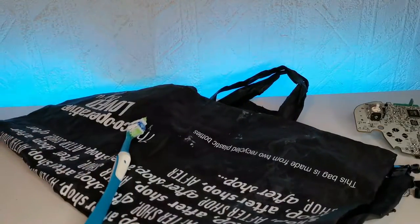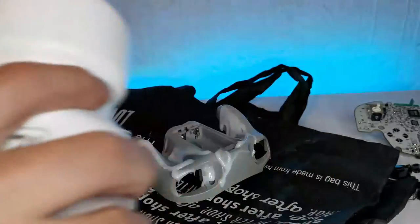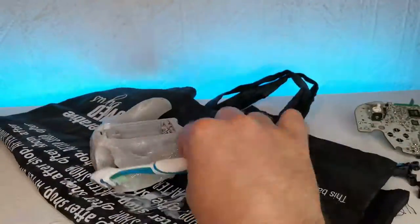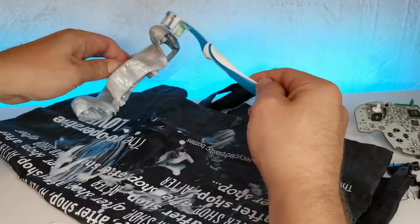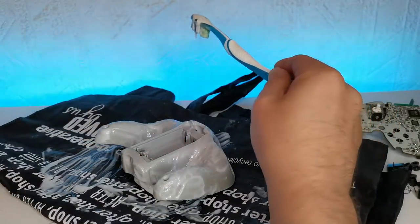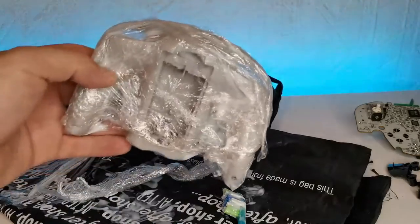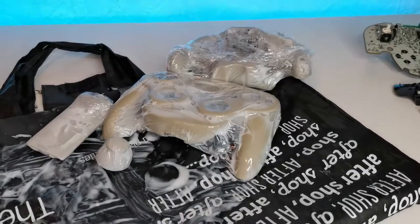Now I put all my bits, triggers, and buttons into one pot in some hot soapy water and gave it a good scrub to get rid of all that grease. Now that everything has been thoroughly dried, we're on to the main part of the show: using Retrobrite. I picked this up from eBay and I've been doing a fair bit of work with this recently. I'm smearing quite a bit using a toothbrush so you can get into those nooks and crannies and spread it evenly. It is highly recommended that you wear plastic gloves because this is a bleaching chemical and it may burn slightly — it did stain my fingers a bit. With each part you want to wrap it up with cling film, just to keep all that liquid together and build that heat in our UV box, which I'll show later in the video.